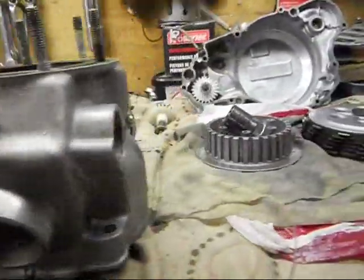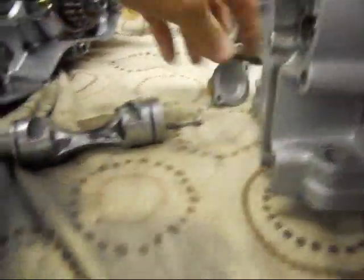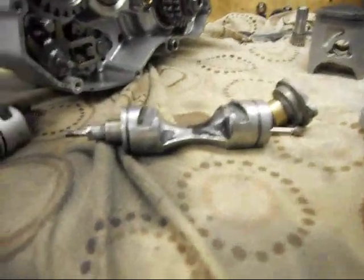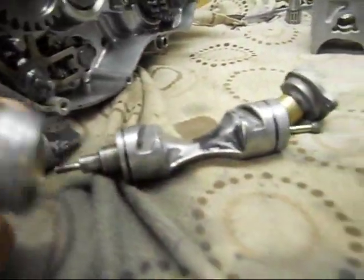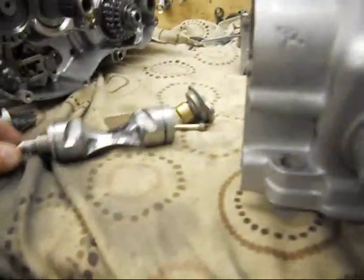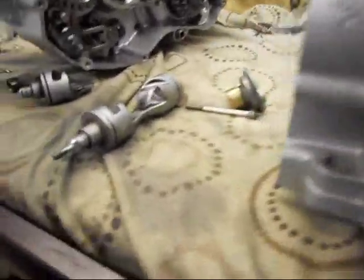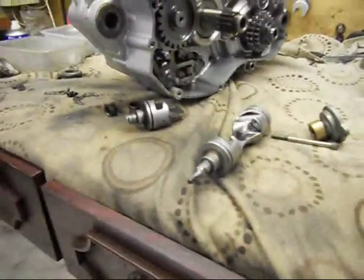I'm going to grease up this power valve linkage and put it back in. That goes in the end there — when it's screwed in, it'll go in with a bit of light grease, molybdenum grease or soap-base, and then this end the same. I had to take bits from the old and bits from the new just to make it work. It just goes in there and turns like that, lets a bit of gas out. If it's not done up properly or there's too much gas getting out it can affect performance.